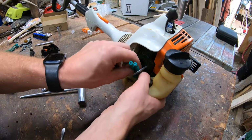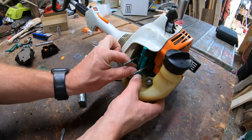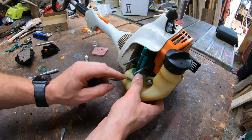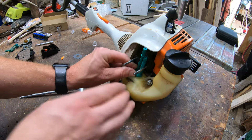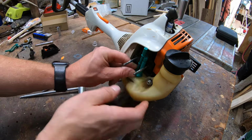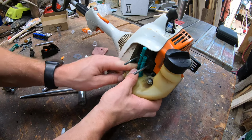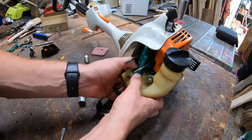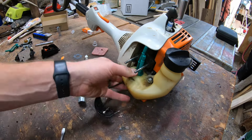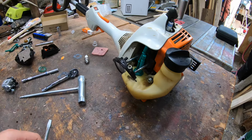This is important. You really need to make sure that this is seated in all the way, or you're going to have problems. You can always take a little bit of white lithium grease and go around where this is going to seal. I try to put the back in first and then pop the front down in. Now, if you decide to use a screwdriver, you need to make sure you're using a screwdriver that has rounded edges if you feel the need to force anything in place.